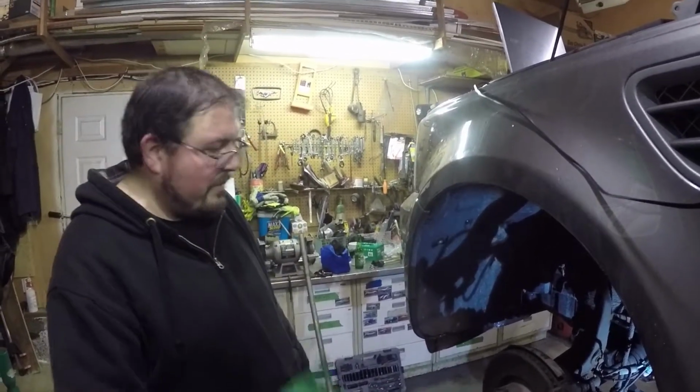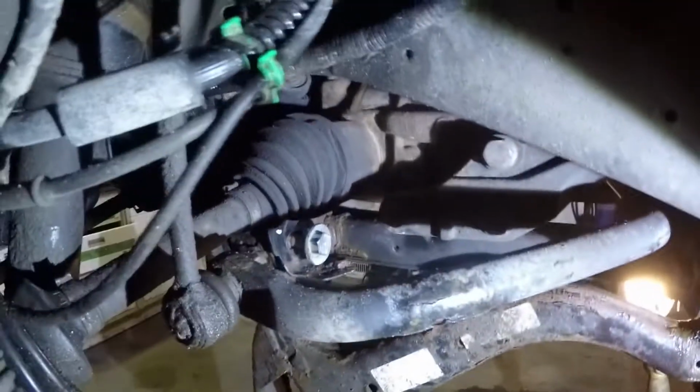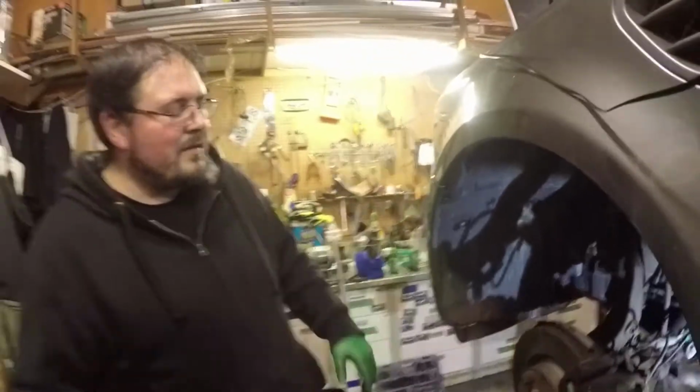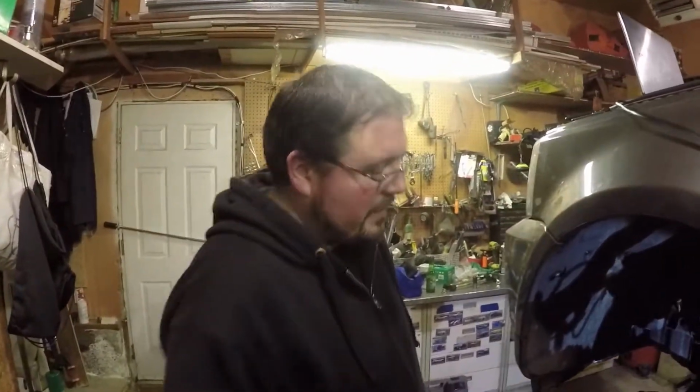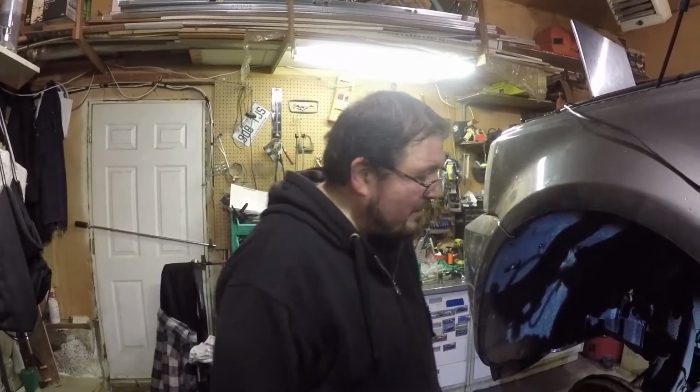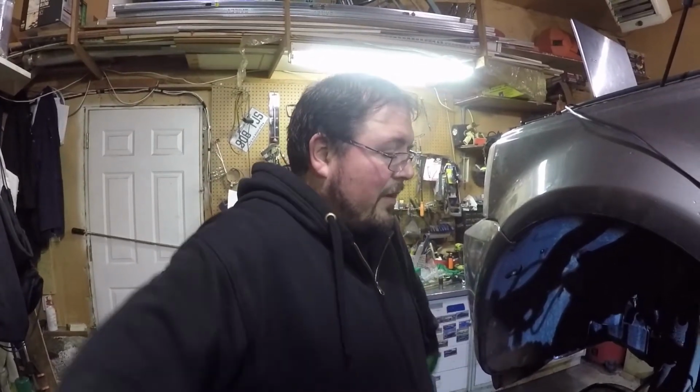So we'll try to articulate that back bushing. We'll take out this nut or this bolt here, the back one, so that we can manipulate and pivot and twist it and see if we can break off some of that rust. Give it some more PB Blaster or whatever anti-seize we can in there, and see if we can get that bolt out. But otherwise, like every other job, you're one rusty bolt away from a 10-hour ordeal.